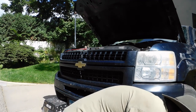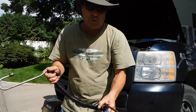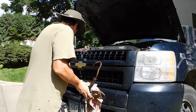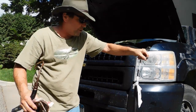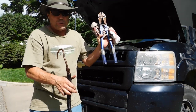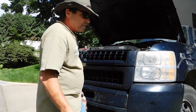The last thing you want to remember is that these hoses ain't always in the best of condition, especially after 220,000 miles. And you want to make sure that you're going to replace them with new hoses. So I got somewhere around here, I got my new hose. Comes complete with O-rings. You want to be sure you're using those. And I don't like to tell people what tools to use, because this time I had to use my bolt cutter in order to slice that guy so I could get stuff out of there easy. How the heck do you ever know? Anyways, that's a quick trick.